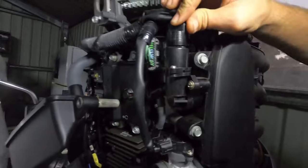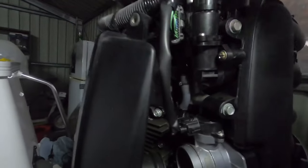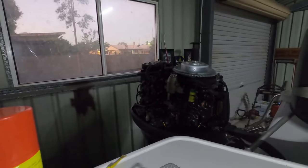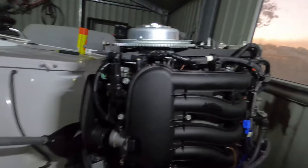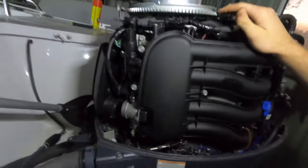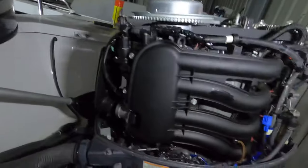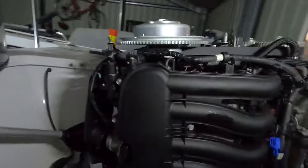All right, that's back on now, plugged in. I'm going to leave this top cover off for now — it won't hurt, there's not actually a filter in there. Just keeping my fingers away from it. We'll give it a start and test it out. There you go — starts and runs! All it was, was the IAC valve. I'll put it all back together, put these covers back on, and it'll be good to go. I'll get some water in this and give it a proper run, but I didn't want to run it any longer than that without water. Thanks for watching guys, hopefully that helped.